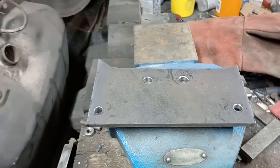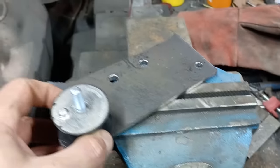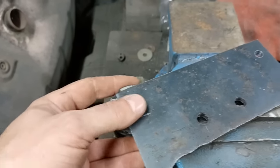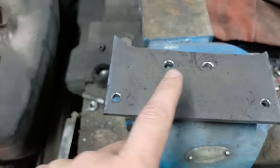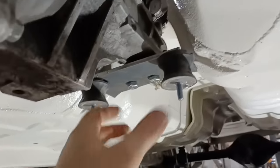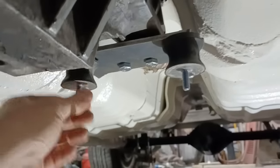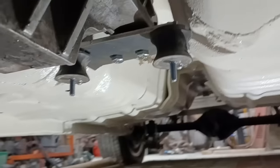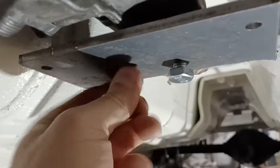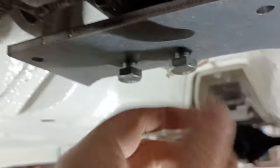I just realized there's a flaw in my plan — I noticed it as I was drilling it out. That's not going to fully support that bushing. It really needs to be the same width as that all the way around there. But what we can do, because we're this far into it, is bolt this onto the car just to give us an idea whether this is going to work. The answer is yes it will work. So the gearbox, once there's a cradle across, will sit on that — a bit of six mil plate across there, not particularly rocket science — lay flat along there, pick up this, lay flat again, and bolt it through the floors sandwiching either side.